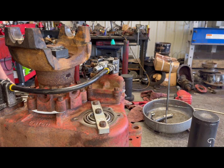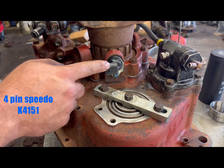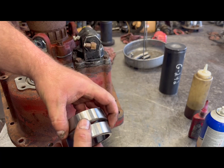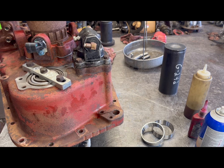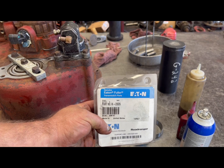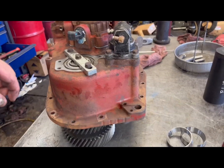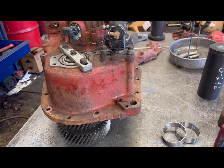We're ready to bolt this back onto the truck. The speedo in there is a four-pin and it's a K4151. Don't forget your two bearing races — those go into the front box housing before you stab this back box back onto the transmission. You'll also need the K2805, which is a shim kit. These are tapered bearings so they have to be shimmed — do that once you stab this onto the transmission. Hit the like and subscribe button. Thank you very much for watching.